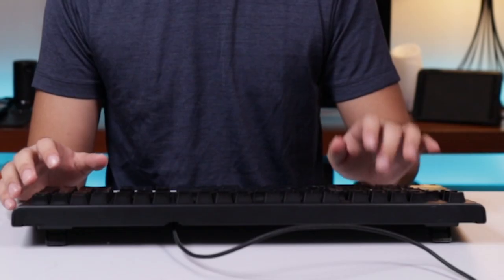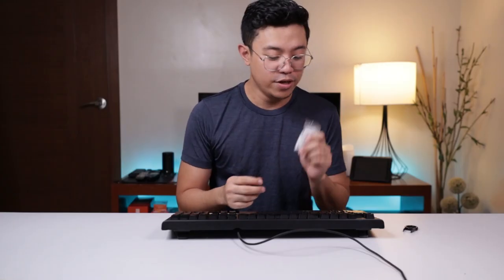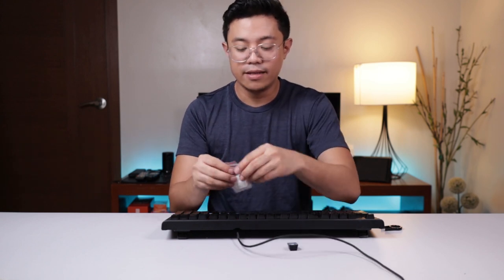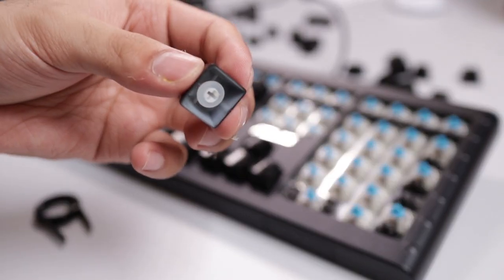So if you're also bothered by the noise from your keyboard — and many of my friends have told me mine is too loud — you can buy these. They're called O-Rings. You use them by placing them on the back of your keycap. Ideally, they dampen the click sound of your keycaps. What you do is remove the keycap, get one O-Ring, insert it into the keycap, then put the keycap back in its slot, and ideally it will be quieter compared to ones without O-Rings.